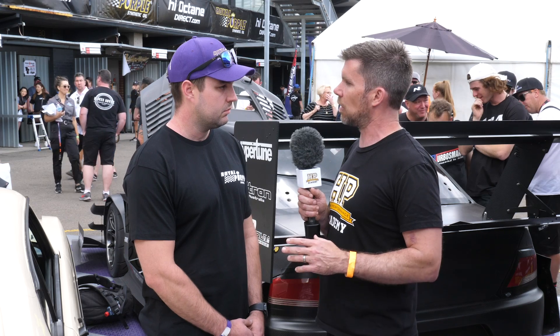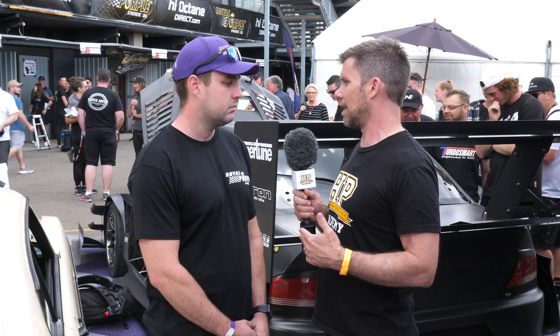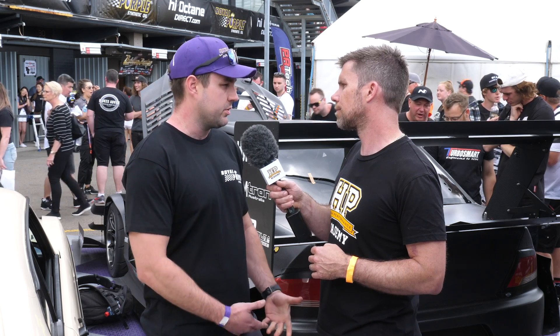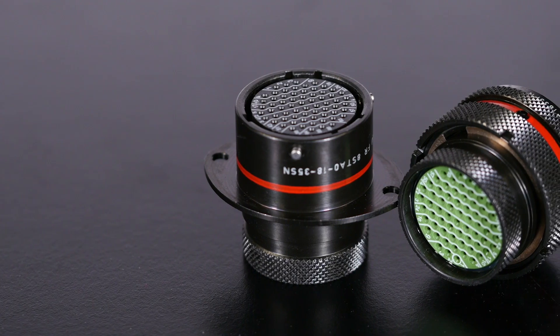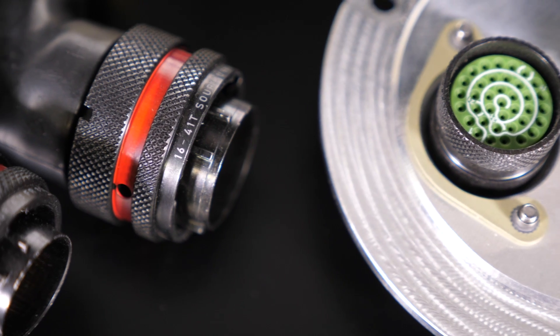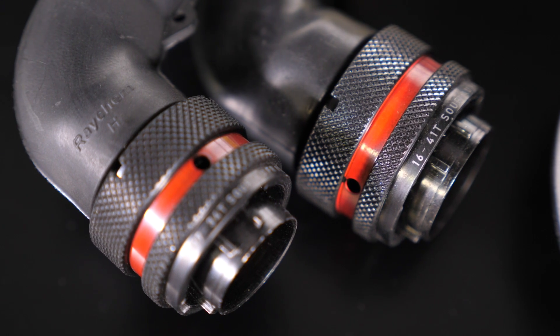Moving on — it's not just about the wire. We've mentioned concentric twisting, but it's also the connectors and the insulating method. Can you talk about those differences? The tooling we use — we only use proper DMC tooling. That's the tooling required to properly terminate an Autosport connector. And those Autosport connectors are really nice, easy to work with, but unfortunately they're also cringingly expensive.